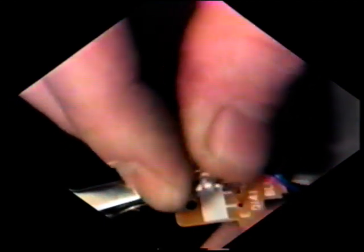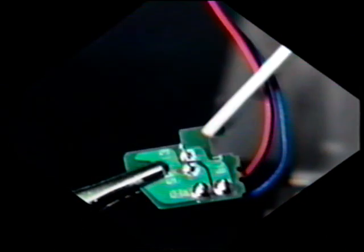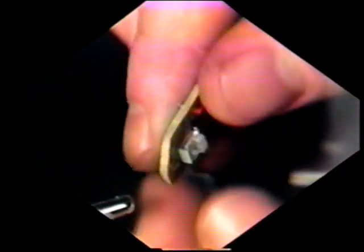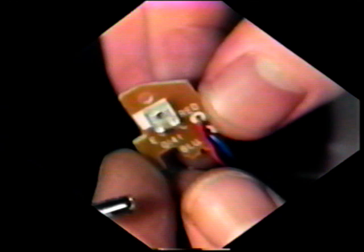After you've done that, reinsert the sensor the same way it came out. Before soldering, make sure it lines up on the white block underneath the sensor. It's now time to resolder the sensor back in. The 2 points are very close, so be careful not to get a solder bridge across. Don't forget to trim the leads. You'll notice the top of this sensor is green.